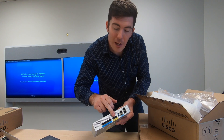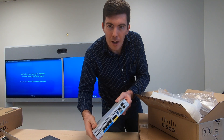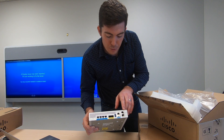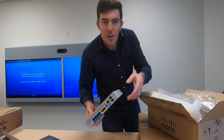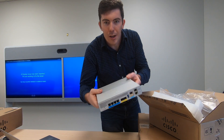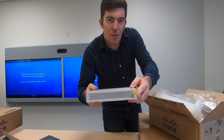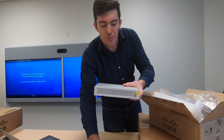Alternatively, you can get this with 10 gig multi-gig uplink ports depending on your application. We have a console port, both USB and your traditional blue cable option, and then there is a redundancy port and a service port as well. You can deploy these with a stateful switchover setup, two controllers in a high availability type scenario, so be aware of that. On the back panel, there's simply just the plug for the power, and you have the power brick to connect that way.